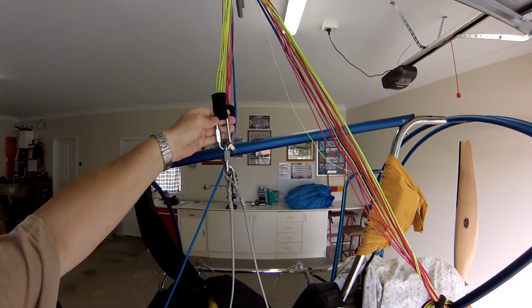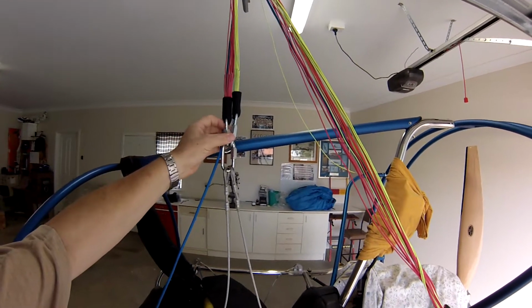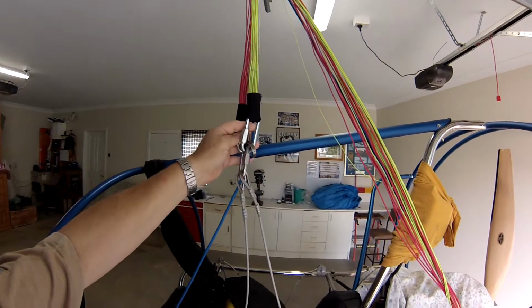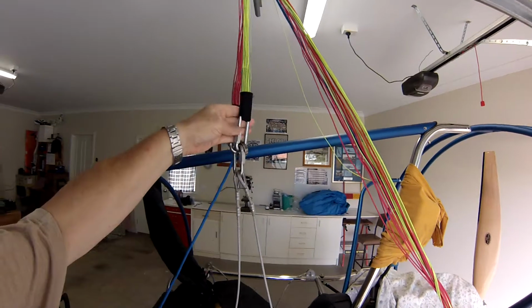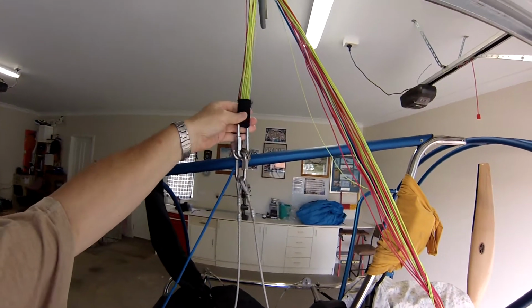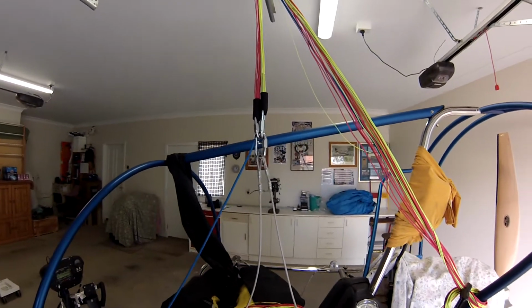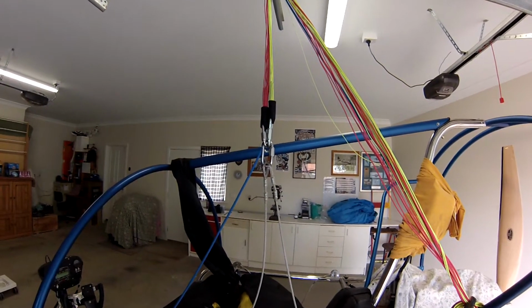It's about 72 millimeters internal diameter, and the standard link is about 58 millimeters internal diameter. So there's a difference of about 14 mil. So it's not a great deal. So what I've done, I've added this to the rear, and what this does, it gives the effect of decreasing the angle of attack on the left hand side, which decreases drag.